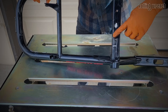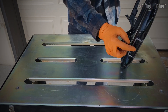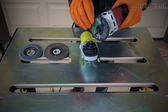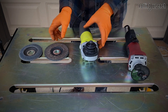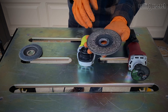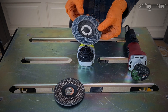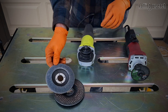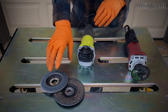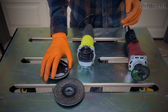Step one done - we got everything cut off but not flush, just cut off enough so we can smooth it out. I cut it down with a cutting wheel, not super close, and then we've got our 90-degree bit. Next step is I'm going to take this type of bit and get it down fairly close to the rounded part of the frame, then smooth it out. The cool thing is you can't do this with powder coating, but if you're painting you can use a bondo-type material to smooth it out, otherwise you've got to be really careful not to go too far into that frame.